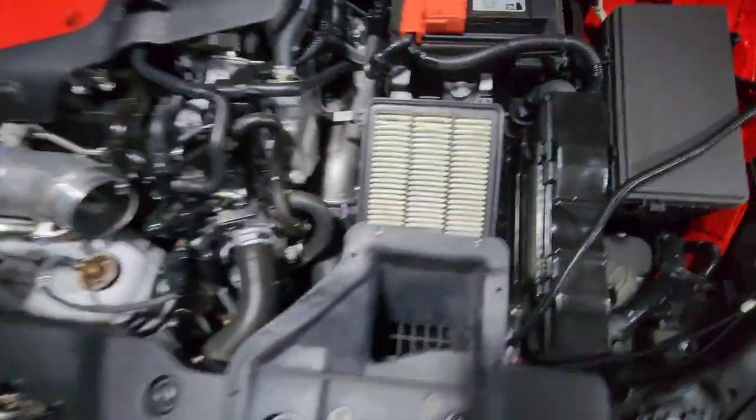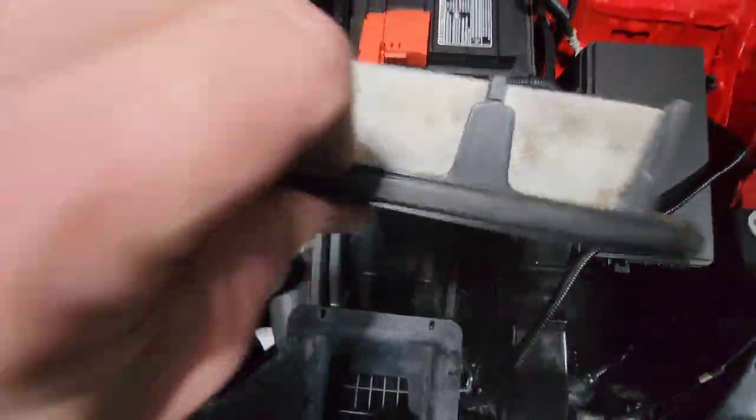Throw that on your hot manifold over there. You got your two tabs — getting your airbox off, you're gonna tilt it up. You've got pins over here on the side, just a plastic tab in your rubber, and that's going to take two hands to release those. Release those, airbox out. Put that to the side because you've got to transfer your MAF.